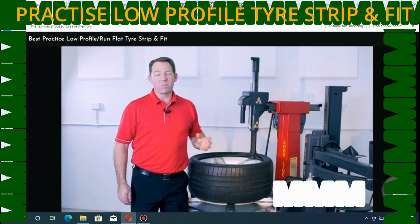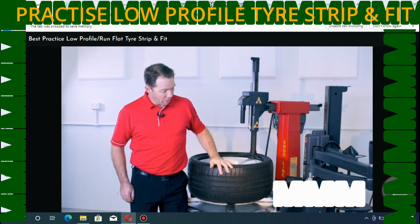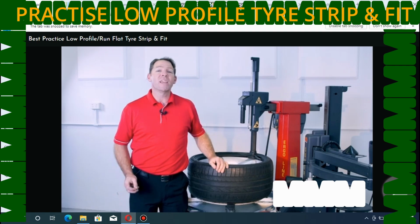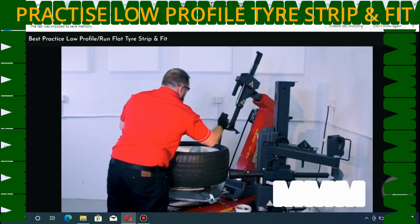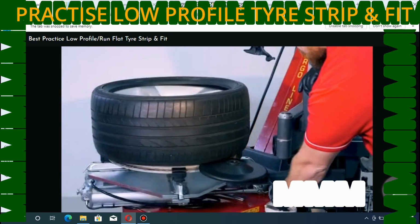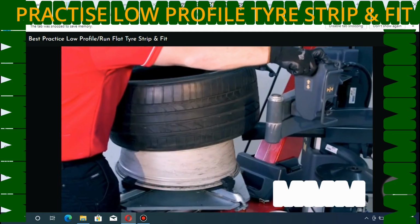On some wheels, it won't be that easy. It's possible for super heavy, wide or firm tyres for the lower bead to reseat, making the job impossible. For these tyres, return the tilt arm to its rest position. We can then use the rollers to remove the lower bead completely from the rim.